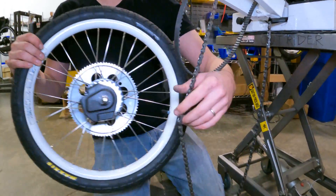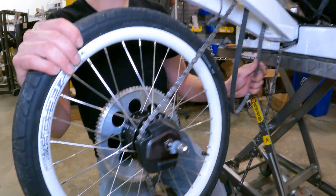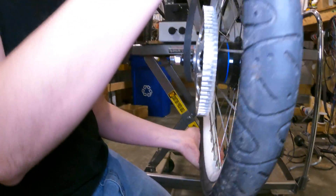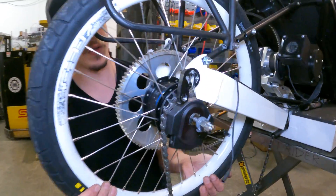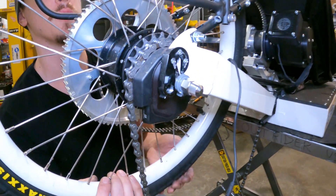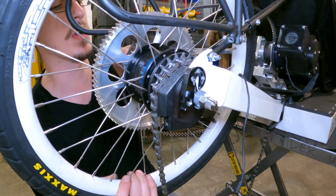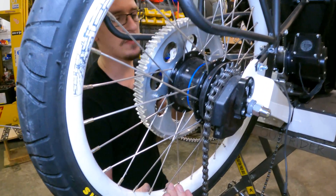As you're putting it on, you're going to loop the chain over on the one side, and at the very least you need the belt over that axle on the other. We'll just lift it back up, being careful not to force anything. It'll go in there without really wrenching on it. If something's holding you up, stop and figure out what it is rather than just pushing harder. I'll put that on there thumb tight to keep it from dropping, and do the same on the other side.